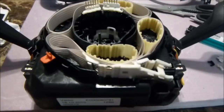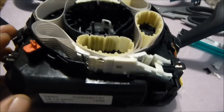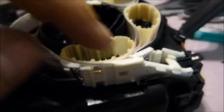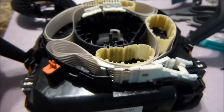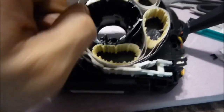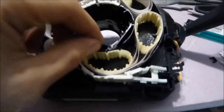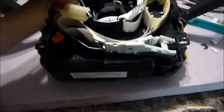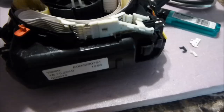Just for the heck of it, I used my Hakko FX-888 soldering iron to solder these joints back on. I cut it and then soldered it on and put the little plastic clip back. I did my best on both — these were completely off. We'll see if it works as a temporary fix until I get the new one in. I'm not entirely sure how the spool works so I just did the best I could and checked that it could spin.